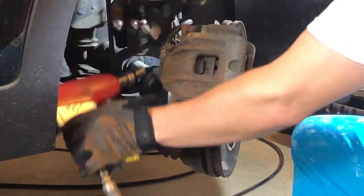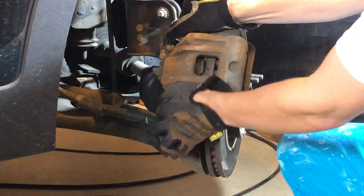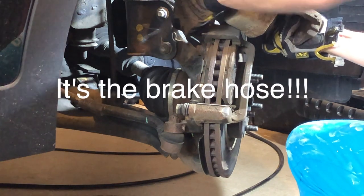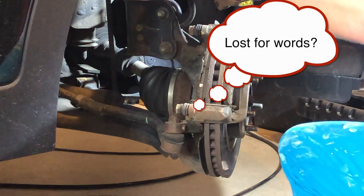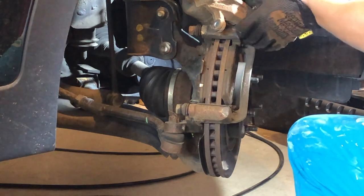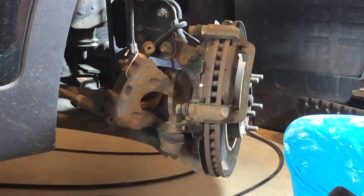I use an air tool to remove the 14mm outer caliper bolts, which makes it a lot easier, but nothing's wrong with wrenching them off by hand. Once we do that, we can pull the caliper right off. Now, another good tip: don't let the caliper just hang, because that little rubber hose has nylon on the inside and the outer rubber is just for protection. What you should always do is grab something to hang it from — attach it to the top of the shock on the spring — so you're hanging the caliper from there and not letting it stress the rubber hose.